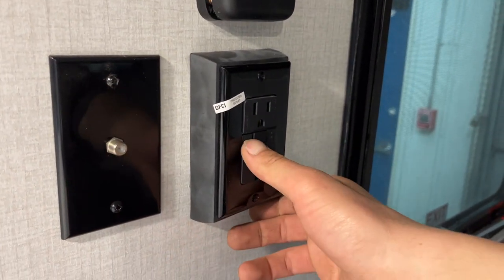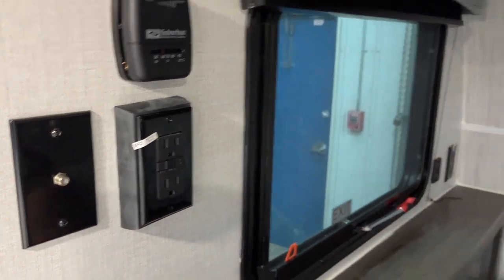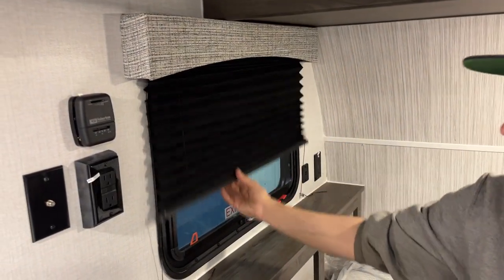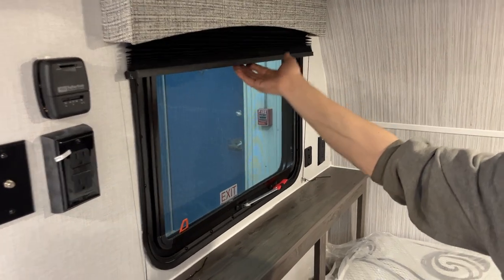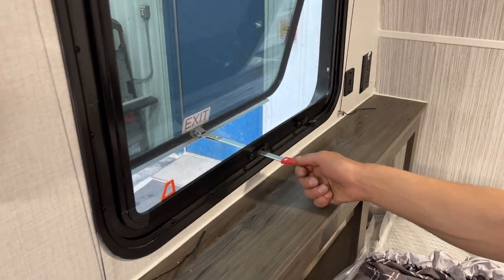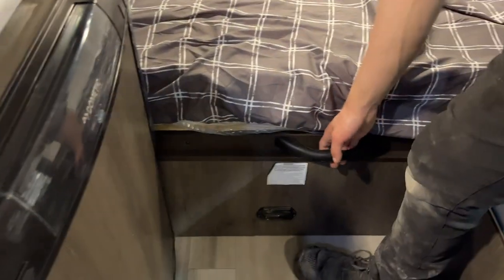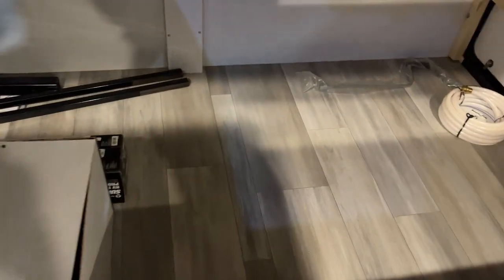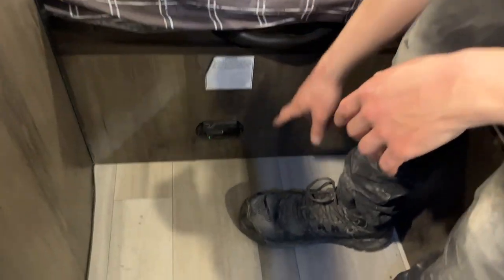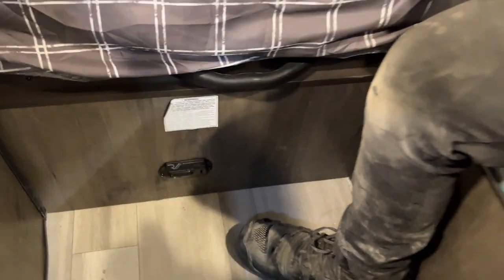Cable and satellite outlets, as well as your GFCI-protected outlets — Test is on the side, Reset is in the center. If you have outlets that don't work, that's the first thing you should check. Above the bed there's a little light. There's an emergency exit here — all the blinds throughout the unit stay wherever you leave them. For the emergency exit, flip it up all the way, use the red tab to remove the screen, grab this handle, throw it outside, and hop out. USB outlet and a GFCI-protected outlet in the back as well. The little handle in front lets you lift the bed to access the storage compartment underneath. Straight down from that handle is your LP detector — propane is heavier than air, sits on the floor, and that detector goes off just like a smoke detector if it detects any.